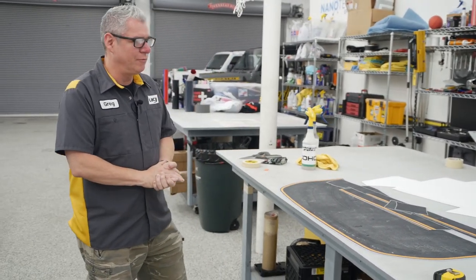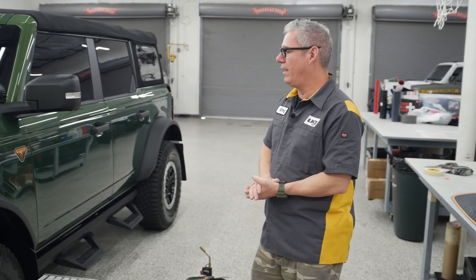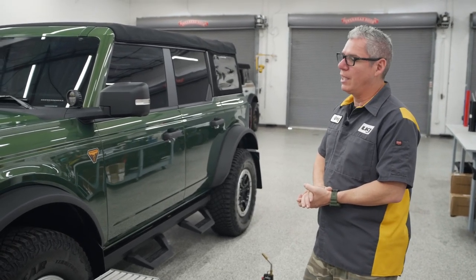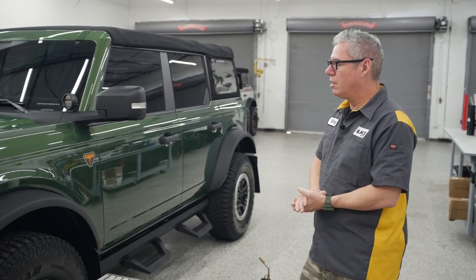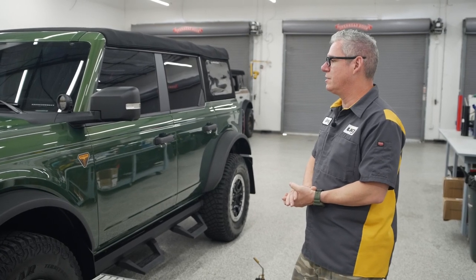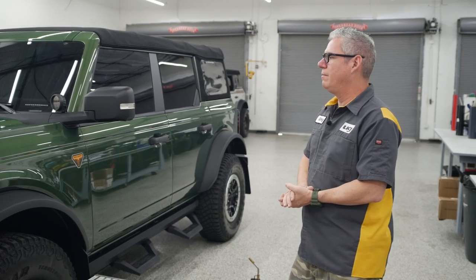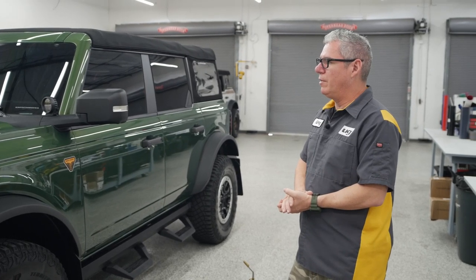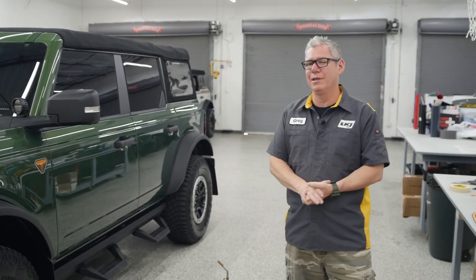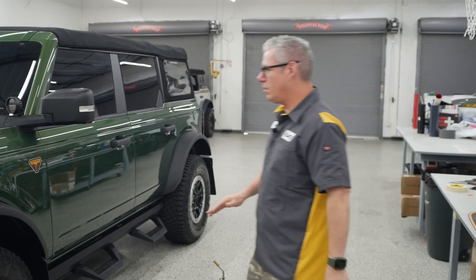Also, upon drop-off, he told us that this has a full XPEL PPF wrap on that. What does that mean for us? Not a whole lot. We're not going to get that adhesion that we would like, but we just want to make sure that we post-heat and make sure that that adhesive is going to get as good as it's going to get. We've done installations on top of this many times before and had little issue. Again, it's that ceramic coating that may give us the issue. And with that, what we would do is just go over it with a light polish, and that seems to work. So, again, we just brought this in a few minutes ago.